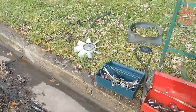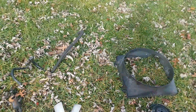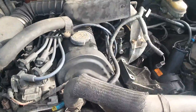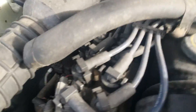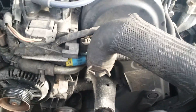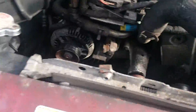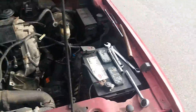Once you do that, you've got to take your clutch fan off. I just cut my AC hose out because the compressor was no good anyway. I have one of these extra pulley things that replaces the air conditioning compressor. Pull this little screw out of the cover and theoretically the cover should pop off. The fan shroud's got to come out too. When I start putting it back together I'll make another video — that'll be part three.